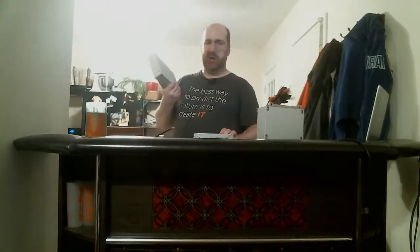And I picked up a CD-ROM drive because all my spare drives I had were serial ATA DVD drives, which are not going to work with this. So I had to buy an old CD-ROM drive. I had picked up accidentally an IDE controller card that will do a pair of hard drives and a pair of floppies. I'm thinking that this will work.